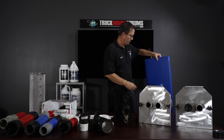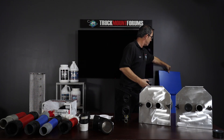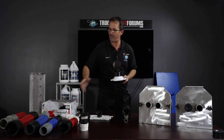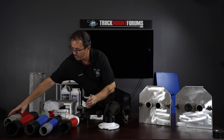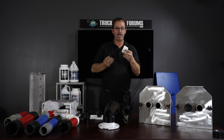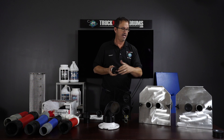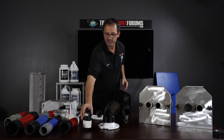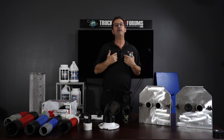What you basically want to do is get your waste tank lid, locate where the filter is, take a hole saw, and drill a hole there. Then you can go ahead and put in a 2.5-inch port — drill it, put it on with a gasket, put the fitting on top, and your 2.5-inch hose will go right in there. Or you can go to the front or top of it, get a reducer cuff along with PVC pipe, put a gasket in, place it right where the filter goes, and now you've got a starter cuff. The 2-inch that comes out of your truck mount goes right to the back of this, giving you four to the door or 2.5-inch to the door. It might take a little modification, but it's certainly worth it.